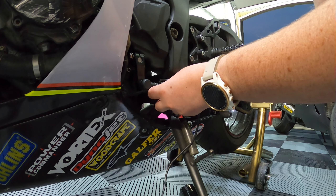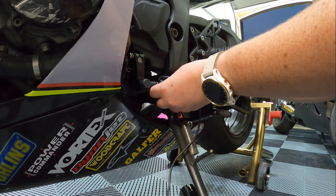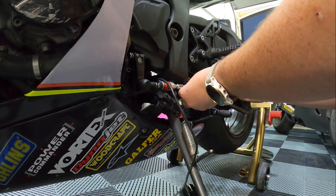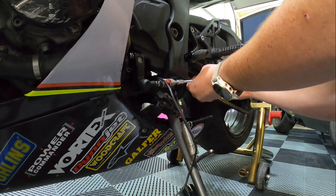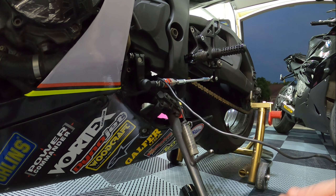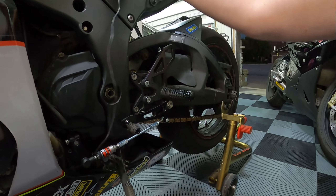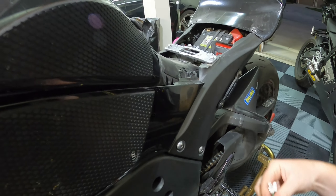Basically what I'm going to do is take my coupler, put the two ends of the rods together, and bring my coupler down about halfway. It's important when you're doing this — this sensor should really be on this side and you want the cord pointing up. Not the prettiest solution that's ever existed, but it'll work. Now I've got to run this cord up under the frame and likely just run it through here under this panel and pop it out into here and go right into the power commander.